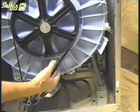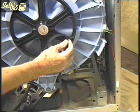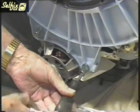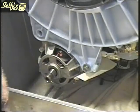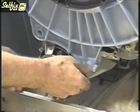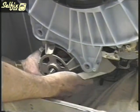Take the belt off the pulley by easing it towards yourself while turning it. For a more visual aid I have resited the container back to front so I can better show you how some actions apply. You on the other hand will be working within the confines of the cabinet. Now with the belt off, loosen both motor bolts by about 4 or 5 turns but don't remove them. With the handle of a hammer tap them back in. This will free the motor from its fixing to make it easier to remove. Now finish undoing the bolts. Hold the motor with both hands because it's heavier than it looks and slide it back away from you.